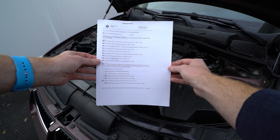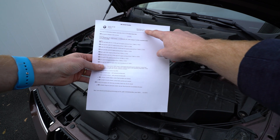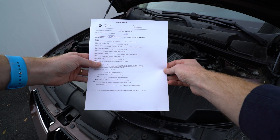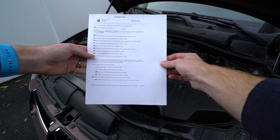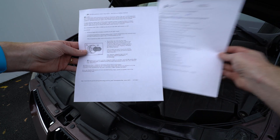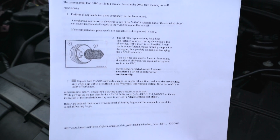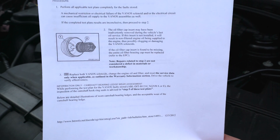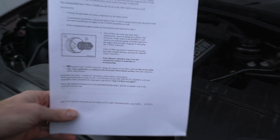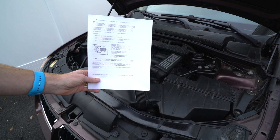Here is a look at the technical service bulletin posted by BMW. It's dated November 2012 and it includes the 2A82 code for this car. On the second page here we can see where it describes the condition with the oil filter cap insert that may have caused the vanos solenoid light. And to read this entire document I will link this in the description below.